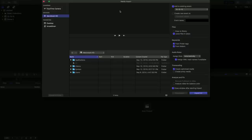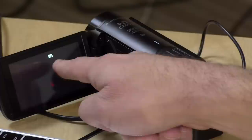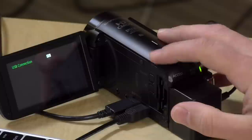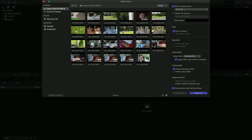I just plugged in the USB cable here. A lot of people have written to me about this over the years — the camera is not found in their video editing software — and that is because you have to click the play button on the camera to switch it into that mode. When the USB is connected and hooked up to a computer, you can see the USB light flashing, and if we go to the computer, we can see the Canon camera is available. You can't just drag the files off the camera like you would from a memory card because it has to be plugged into video editing software or some kind of photo transfer utility — it just doesn't show up as a USB drive like many other cameras do. That's why it's easier to shoot on the SD card itself.